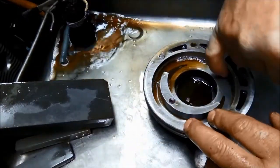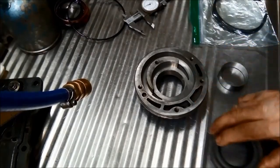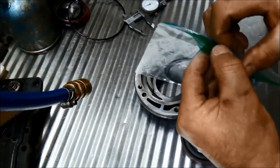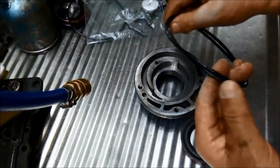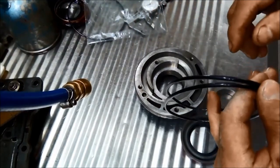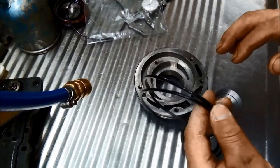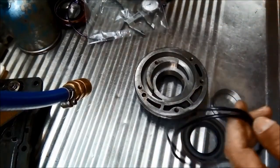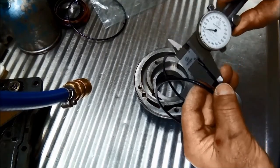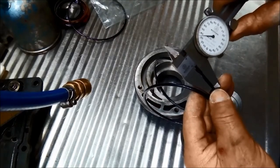Especially when the bore in here is a little bit worn. Now we've got the new seal and new bush. Put your new o-rings in - the extension housing o-ring and the front pump o-ring should be the same, but because the pump is a lot harder to get to than the extension housing, I always like to measure up and see which seal has a better cross-section. That one's 134 thou.